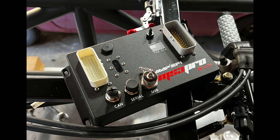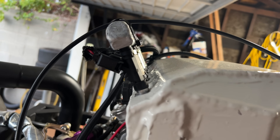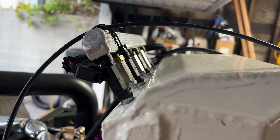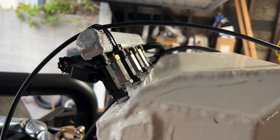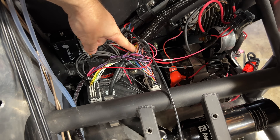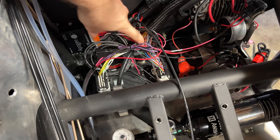On the LandSpeed car, I went with the bigger MS3 Pro because it has several more inputs and outputs, faster and better data logging, and it's a bit better at dealing with things like boost and different fuels. I also got my fuel injectors from DIYautotune — some 72-pound-per-hour Bosch injectors. These will be able to flow a lot of fuel, so I can slap a turbo on this guy at some point and see if I can blow it up. I'm not going to get too deep into the wiring and tuning specifics because I have two previous videos on that — links in the description.